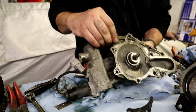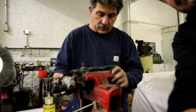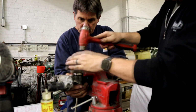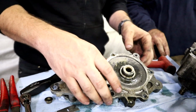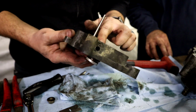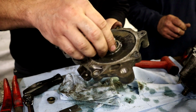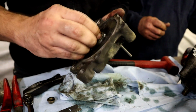I mean, looking at the new seal here, this is metal and it's just rubber on the inside. Look. There. Now we're solid against this. There you go. So now we have to figure out... All right, so what we found, guys, once you flip it over, there's more than one seal in here, and this one's hard as a rock right here, which is another seal that we have. But this one right here is what actually is going to keep the power steering fluid separated along with this weird contraption here. This is what seals your water pump here.